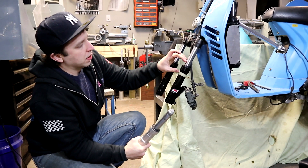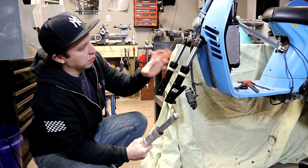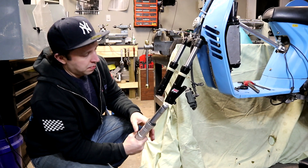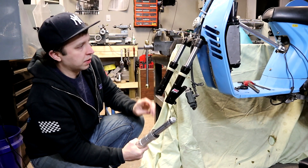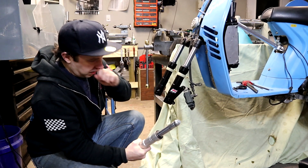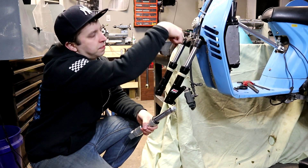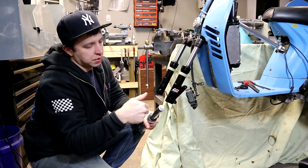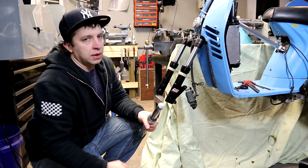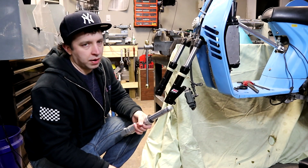The other thing is the more you lower this — the slider in the lower leg can move down — the more rigid the fork ends up being, but then you run the risk of bottoming out the slider leg in the bottom of the fork, even though you have leg left at the top. But there are ways around that too, like you could machine the top — cut the top off and then remachine, put a new thread in for a top cap — so that's getting kind of ahead of myself.